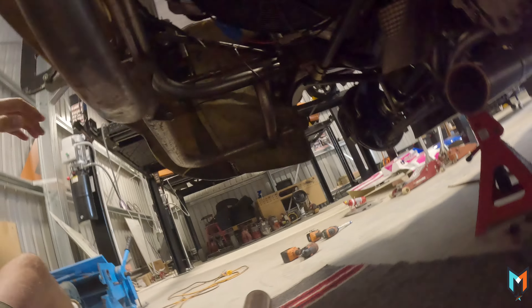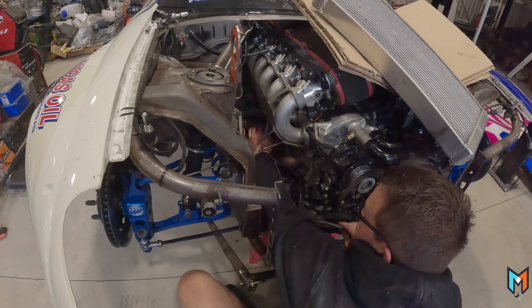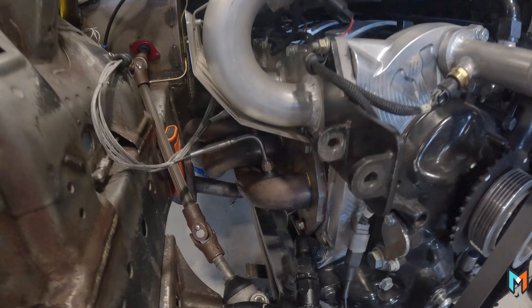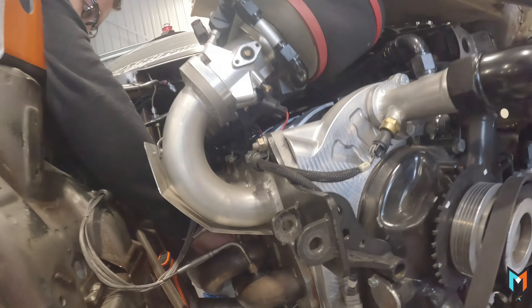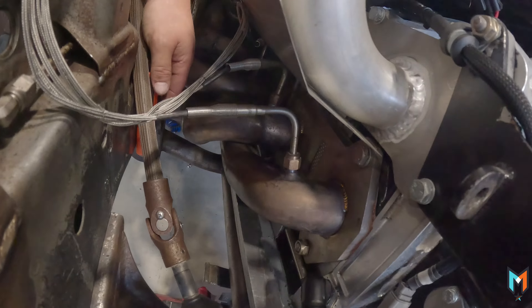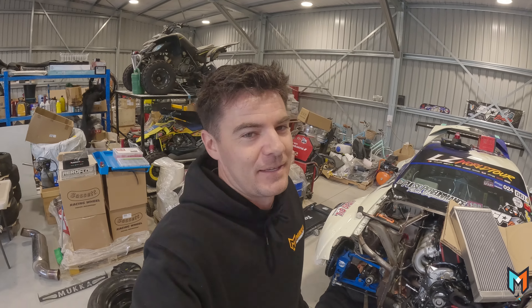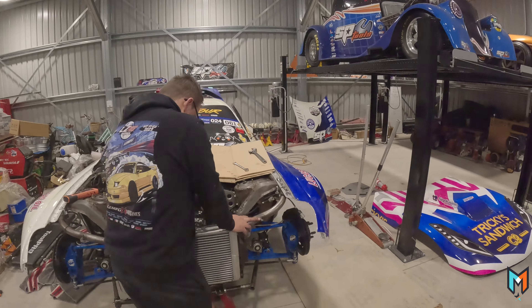We've got the master cylinder tucked all the way up there for the handbrake - we're going to give that a bleed and see, but we're pretty sure the seal has blown in the master cylinder. Got the alternator out of the way, oil cooler up there, and we're tightening up all of the exhaust manifold bolts - they've come loose. That exhaust manifold has got six pipes and six pyros on it and it's just hard to get into all the places. We managed to get the top four with just a socket ratchet on three-eighths drive. The other ones we're having to cut spanners down - sacrificed some old tools and cut them to length. Me and Dan reckon we are actually becoming highly qualified six rotor mechanics.